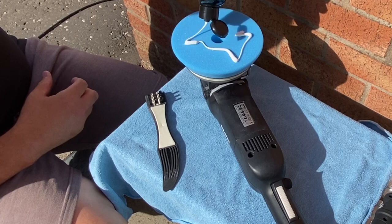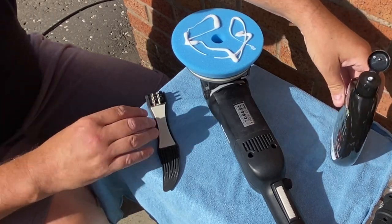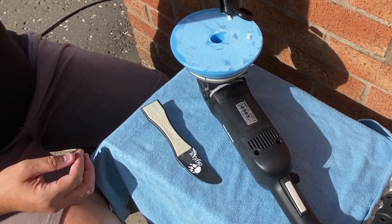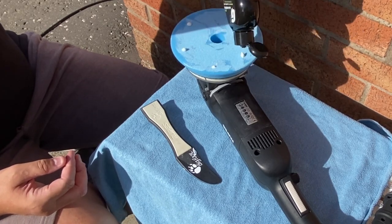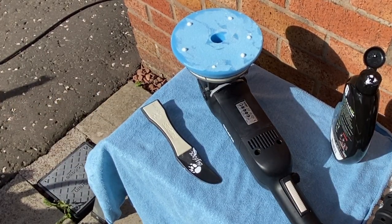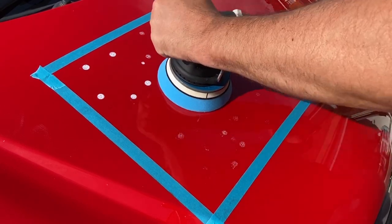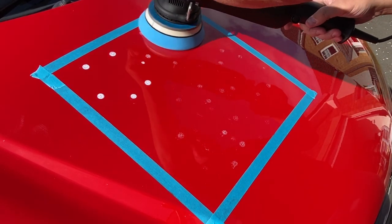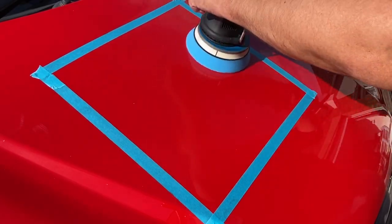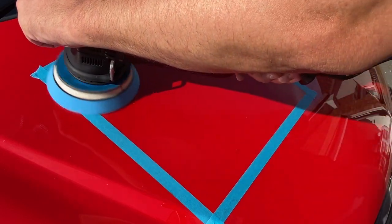As it's a brand new pad, I'm going to prime it with the polish - that just means spreading some around the face of it so the pad isn't spinning dry and chafing the paint. Some brands recommend a pad conditioner; I just spread some polish around it, then add a few pea-sized drops of polish on the pad and tap it out on the area to be polished. This helps prevent polish spraying everywhere when you start up. Once you've got the polish dabbed over the area, use speed 1 just to make a film over the area, then increase to speed 4, with a movement speed of around an inch a second, overlapping passes left and right all the way to the bottom, then changing direction to vertical.